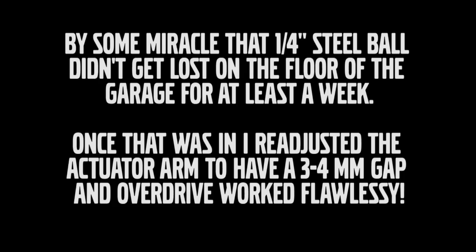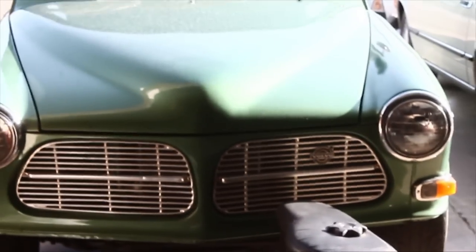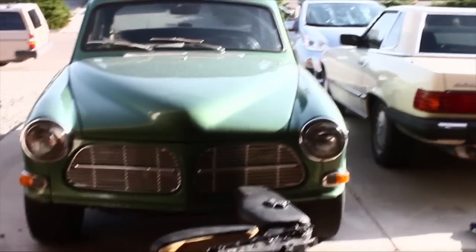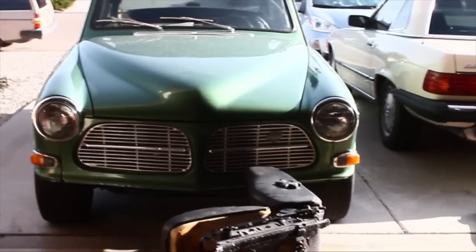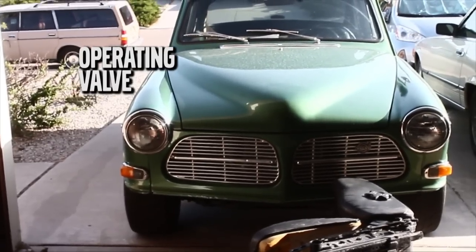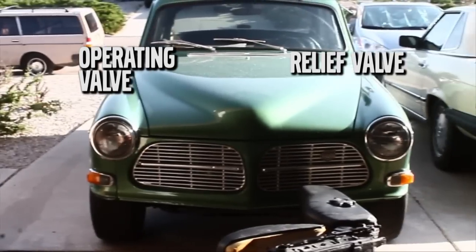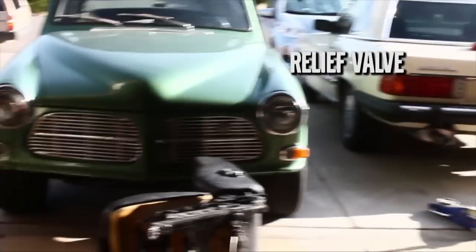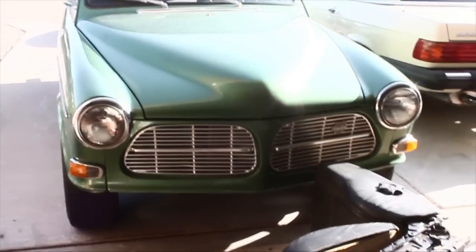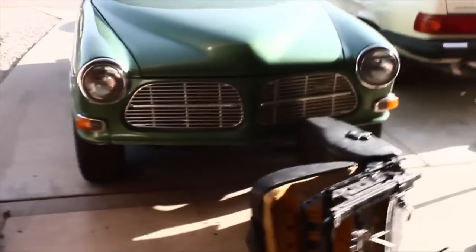There's an O-ring to change on this too. It's a real miracle that I got this thing finally done — the overdrive works, praise the Lord. What happened was cleaning those valves — the pump valve, the back pump — cleaning those out was what I missed the first time. And this morning the overdrive was actually engaged all the time because the throwout on the solenoid was adjusted opposite. Moving on: fifth gear works. Hallelujah.